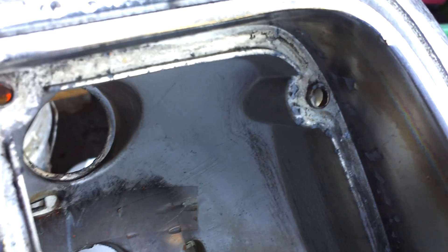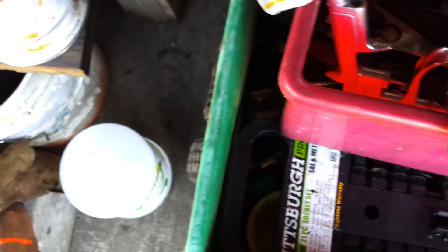It has pitting and it had some corrosion pitting through the chrome that was kind of high up, making little peaks. They were kind of sharp because of the chrome. I took a brass brush — this one right here, a brass little brush I got at Harbor Freight — and I scraped and scrubbed at it.